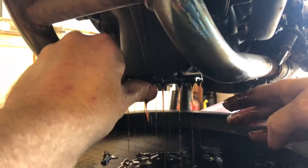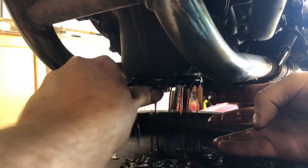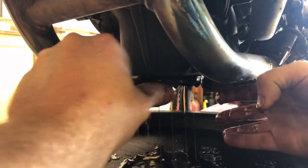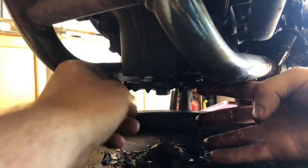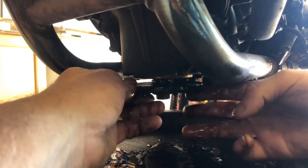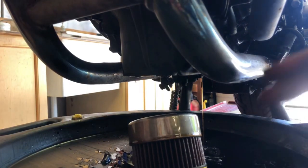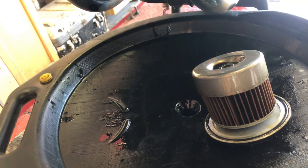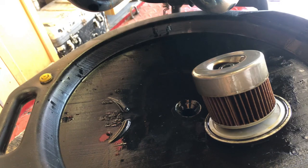Usually once it comes loose you can just spin this outer piece here because it's got an o-ring in there — it kind of sticks to itself. I really hate these old paper style filters like this. Usually you don't see stuff like this on bikes newer than the 90s. Most of those have a regular spin-on filter, but the Ninja 250 is based off of an old 80s bike. Okay, and there's the filter. Here's a closer look at the old filter and here's the new filter I bought — there really isn't a brand name; I just bought these as some no-name bulk filters a long time ago.